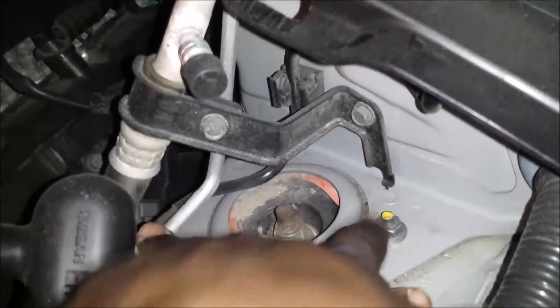Up here is your upper wishbone, or upper control arm — I have videos on removing that for this platform. Among the benefits of double wishbone is enabling the wheels to maintain camber when cornering. The upper wishbone has a big bushing where it joins the subframe. The strut assembly — coil and strut combined — bolts to the lower wishbone down here.